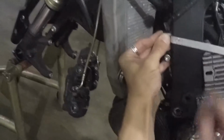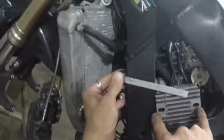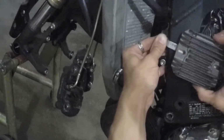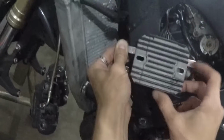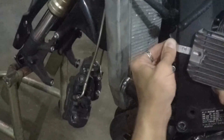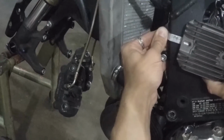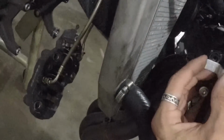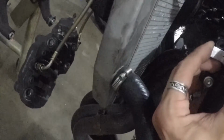There it is. So I'm going to have to drill one hole here to hold the bracket, 2 holes. We'll go somewhere in here. Be able to tighten it down, and then I'll end up cutting this edge off to trim it so it's not sticking down. Just like that. Gonna double check where my hole's at. Changed a little bit because of the bending.